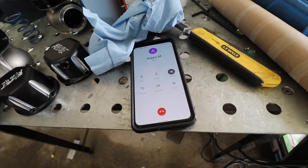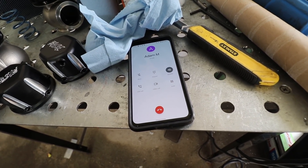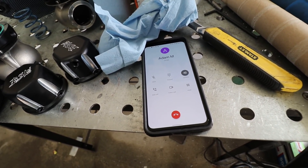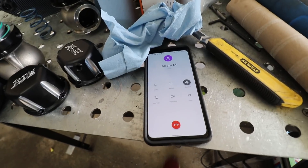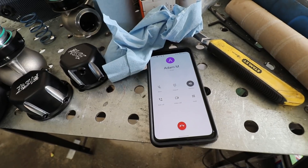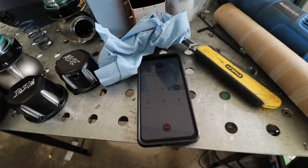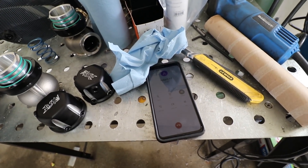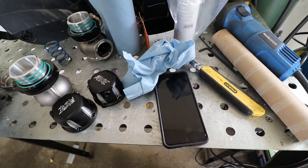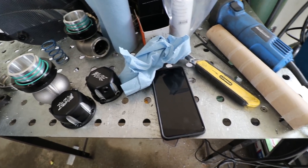My experience with that octane booster is it's good for a bit more, but not like huge more — it's definitely not race gas status by any stretch. Like I've done it on quite a few cars, and usually if I'm running like 20 pounds on pump gas, maybe I'll run like 23 or 24 on that octane booster. So if we're good for like 13 to 15 range pretty happily on pump gas, you still might not want to run much more than 18 or 19 pounds on that stuff depending on how strong you mix it.